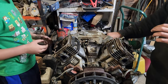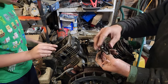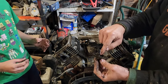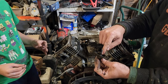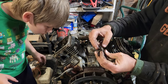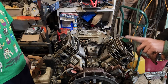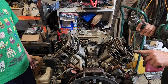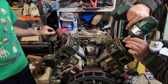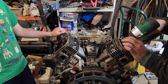Okay, so I know I'm going to get questions about this. So on a Briggs & Stratton Intek, you adjust your rocker here. On these, you adjust your rocker on this side here. So we got 1, 2, 3, 4, 12 millimeter. I don't know whether inch-pound is going to do this, but we'll try it with the metric first, and you can try your inch-pound. Go ahead.